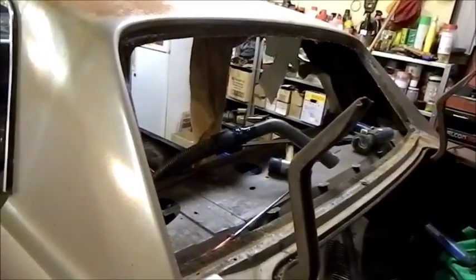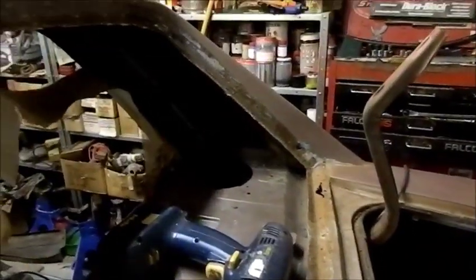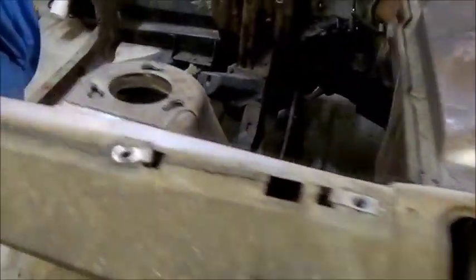So, pressing on. All right, so the back window's out now. Not great news. A bit of rust there. Hole around the other side. So that's going to have to be cut out and re-welded. At this stage, the ugly bits are sort of in here, just a tiny bit there. That's not too bad, but it's a bit scaly, and we'll probably need to cut that out anyway. Around there, and also the front floors. So the rear ones at this stage don't look too bad. I might get away without changing the rear ones, but the rest of it looks pretty good.